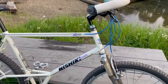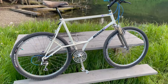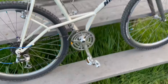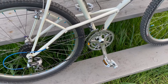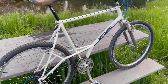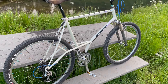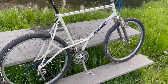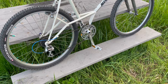Okay, so the first takeaways are positive — it rides great. The infamous bottom bracket flex is evident a little bit, but you have to look for it, and what are you comparing it against? This is before suspension frames, so everyone had a hardtail — aluminum hardtails — and you were splitting hairs over half an inch chainstay length difference or half a degree seat tube angle. So yeah, there's a little bottom bracket flex.